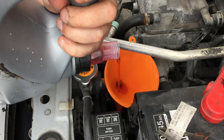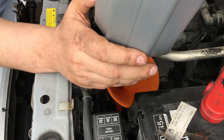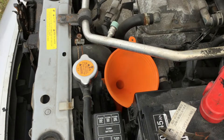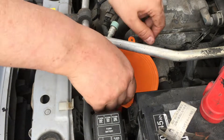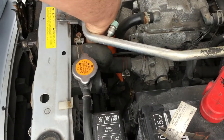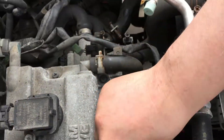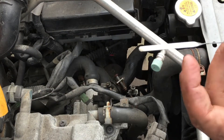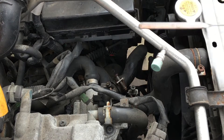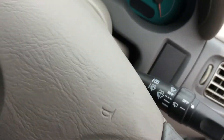I had two and a half litres of fluid. The HCVT — which mine uses, with the conventional torque converter — takes two and a half litres for an oil change. There is more oil remaining in the heat exchanger and torque converter, but the sump itself holds two and a half litres. If you haven't changed it in years, it might be worth buying five litres, doing one change, taking the car for a drive, then doing another change to flush as much of the box as possible. There is also an oil filter on top of the box you can change — buy it from Nissan.